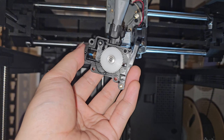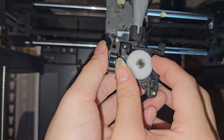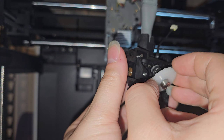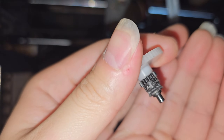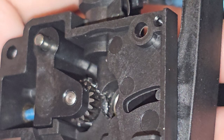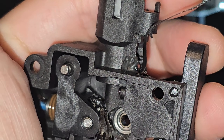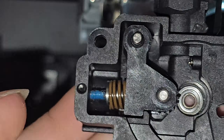That's just the back cover. Look at this — it appears to be just a plastic gear. Taking it off carefully — oh wow, look at the filament gear. It has nasty buildup on it. And look right there: filament is stuck in the gear. It's black TPU stuck right in there. You can unscrew this to release tension or screw it in to get more tension.